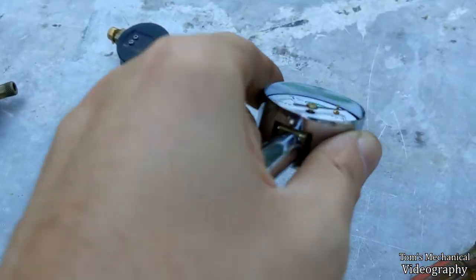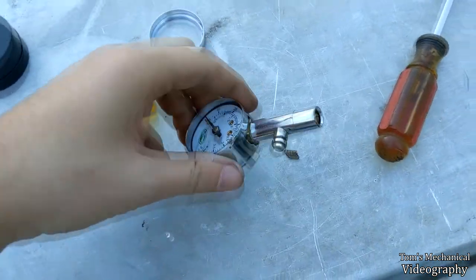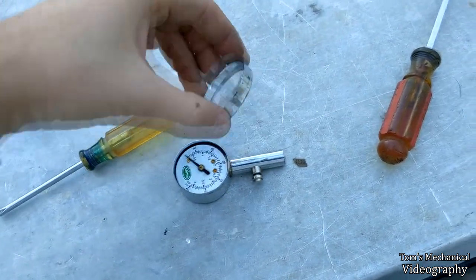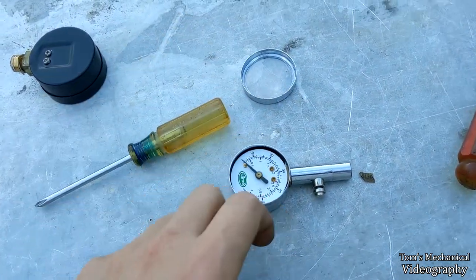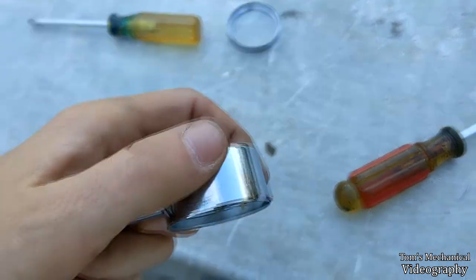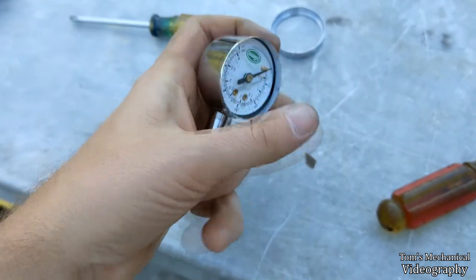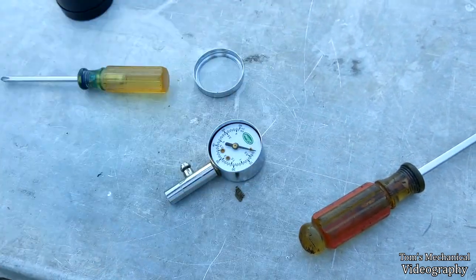In the Slime one, it's a square hole, so it's a little bit trickier. You've got to jam the screwdriver in between the brass block and the housing, then twist up and pry all the way around. Then just slide it in with some force all the way around and knock it off. Once you get it free enough, you can usually grab it, twist it, and pull it off.